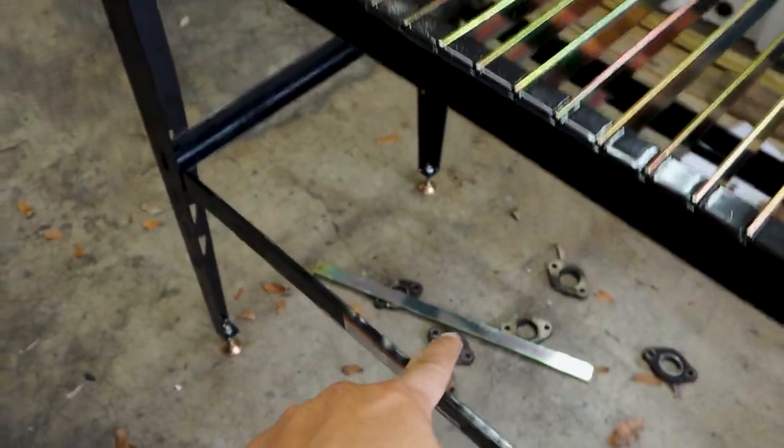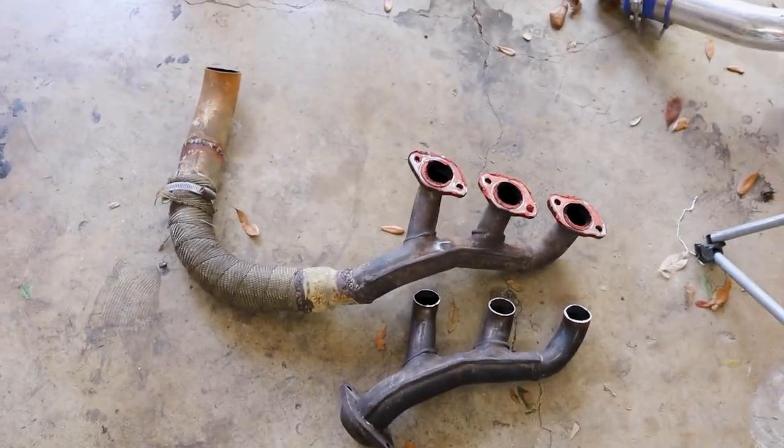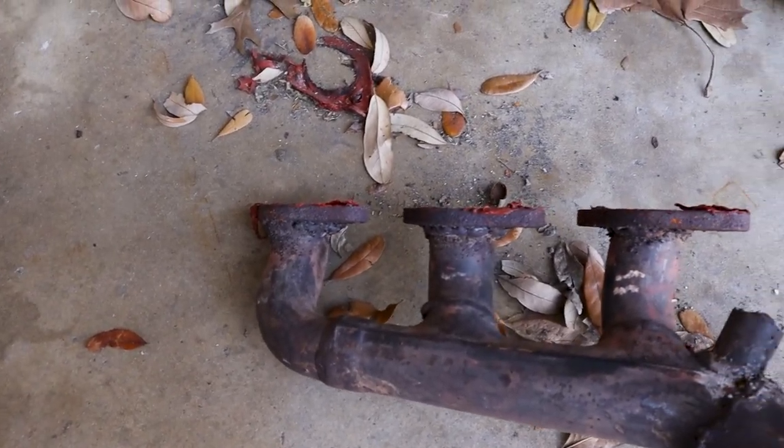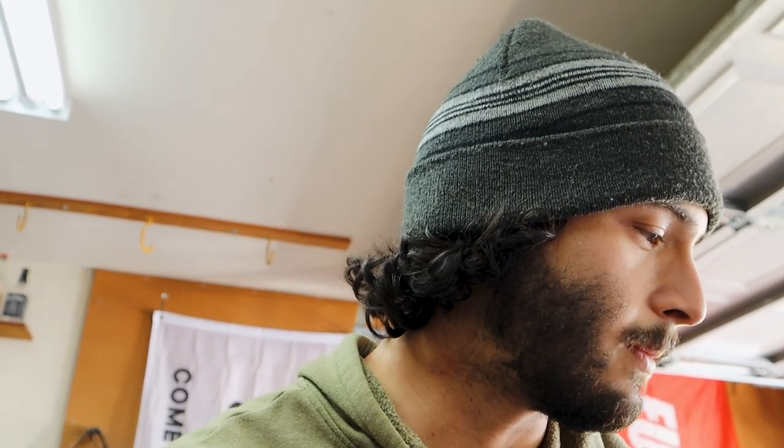I forgot to mention that I cut the headers a little bit ago, so I got the ends off of them. That way I can start finally matching them up to the ones that we cut last year. But this time we're going to do it a little bit differently because we messed those up really badly — one side is definitely a little bit shorter than the other. This year we're going to take it more seriously, get a straight line cut down the middle on all of them and make sure they're all level, so there's no air leaks — because I'm sure that's why we were making no boost last year. Then we'll map out the exhaust pattern, which will be the same: wide to center with a turbo.